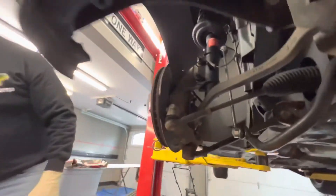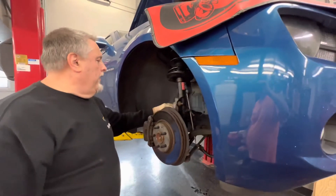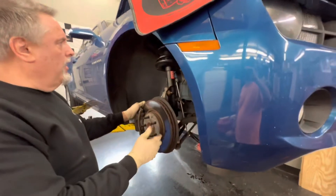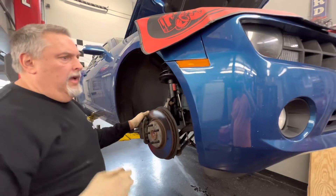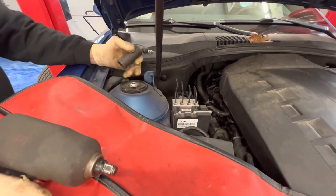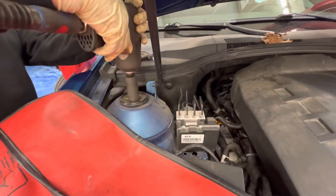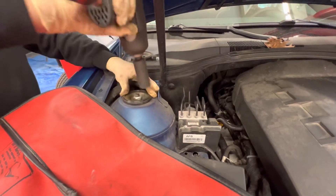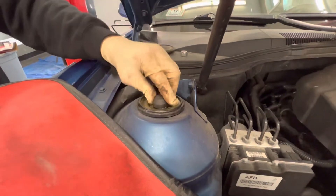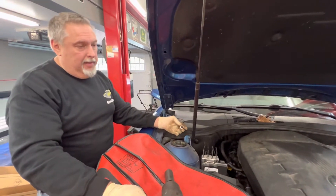All the big bolts are tight, ABS sensor cable secured, brake line secured, and the stabilizer link is secured and never-seized. Bungee cord is off. We tighten the top nut using the factory 15/16ths socket — the threads are mint so we're good. The stud is sticking up enough now, so we take the cap and lock it back on. The customer wanted to see the cap rather than just the bare nut.